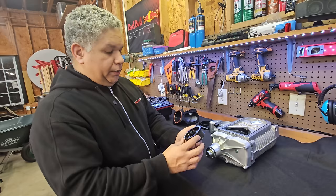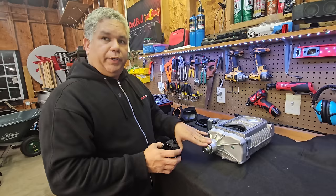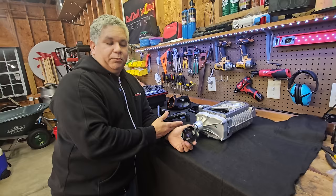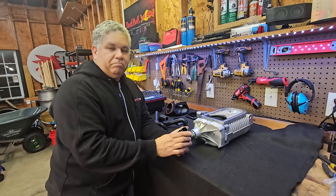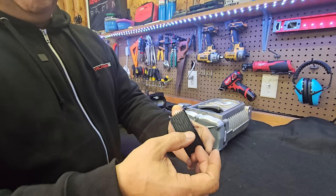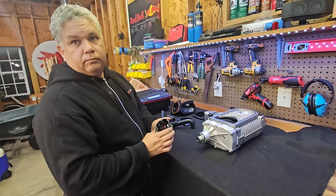These pulleys are available only from us — GripTech was kind enough to make this design and make it available. The base pulley that comes with these kits is a 3-inch pulley, which is around 72–73 millimeters. It's way bigger than OEM, which means we're not pushing this blower as much as people are doing with the 1320 — so there's room to grow. What's special about this pulley is that GripTech makes them with tiny laser-etched grooves that allow the belt to grip really nicely and not slip easily.